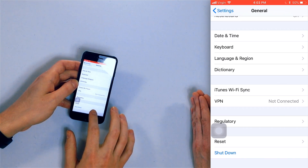So you shut down your iPhone — tap Shut Down, slide to power off, connect it to a power source using your Lightning cable and it turns back on automatically. Now we're going to test again: is your power button still not working, or does it work? If it works now, all of a sudden we've got a software issue and we need to fix that.